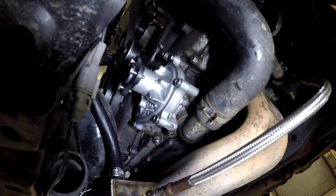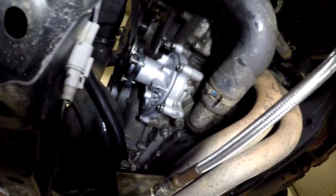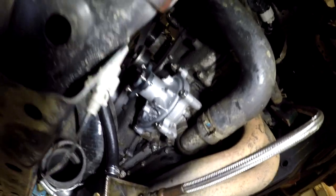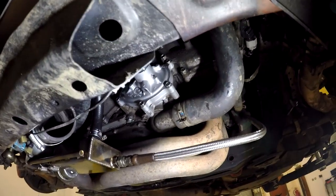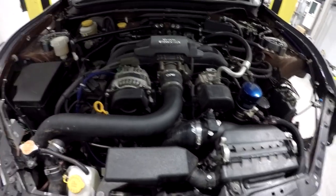There we go, she's on. Now we've just got to get the pulley back on - hopefully these bolts I've used are going to be alright. The head's not much taller than the previous ones so hopefully they won't get mashed into the inter-cooler pipe, but we'll see. Let's get the pulley back on, get the belt back on, and then refill the coolant, start her up and see if anything leaks. I've just spent some time bleeding it - seems to run alright, no leaks, so we'll call that a success.